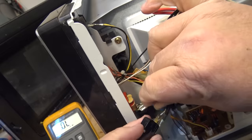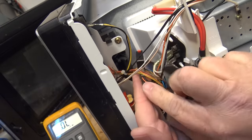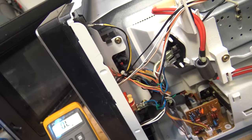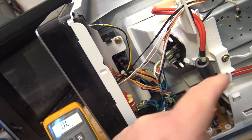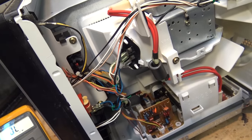Let's check the monitor switch - or short switch as it's sometimes called - and see whether that's the one that caused the failure. If both switches are okay, then we'll check the transistors on the inverter board and look for a short on either the rectifier or the transistors. If the inverter is shorted, this unit is not going to be repaired - cost wise it's cheaper to buy a new one, same as if the magnetron is shot.